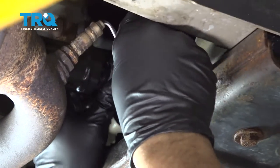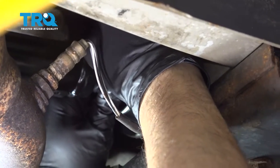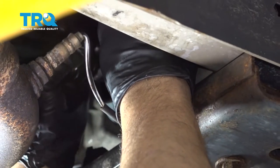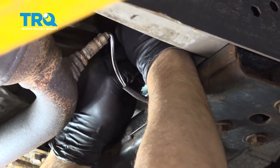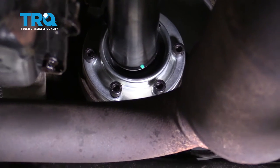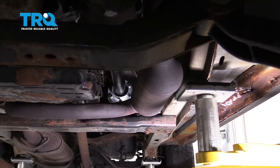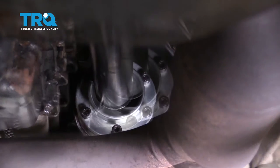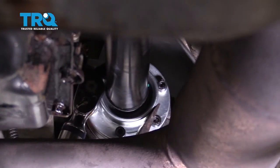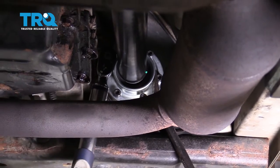Let's move on to the rear — repeat the same process, lining up the flange bolt holes. Work a couple of bolts in, slowly moving the driveshaft back and forth so you can feel them catching on the holes and get the bolts started. With those two bolts snugged up, we've pulled the driveshaft into the yoke evenly. Now go to the other bolts and snug those down, then torque all of them to 22 foot-pounds. We're going to use a pry bar between the bolt and the flange to keep it from spinning.